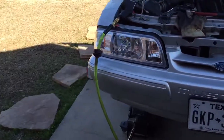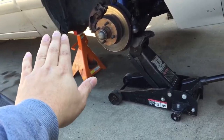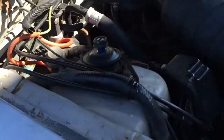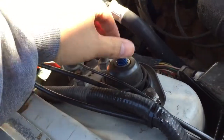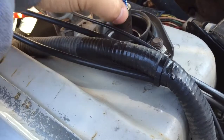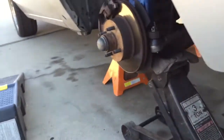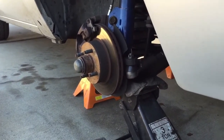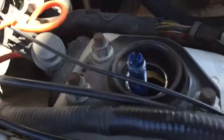The speedy part: they tell you you've got to take everything apart, but you really don't. I just took my wheel off, used a jack stand to support the subframe, and I'm using the jack to push up on the spring. That allows me to easily take the shock off, which I pretty much already got done. You pop all this off — most of the pressure is off, which is good enough.